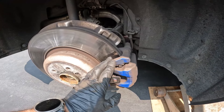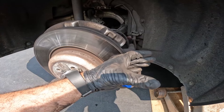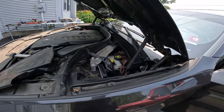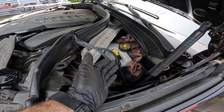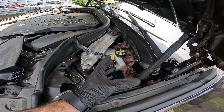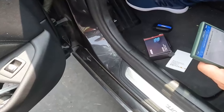Pro tip: do not take the brake caliper off on either side when you do this, because when you command it to retract it actually first expands then contracts. If you have it off, you'll blow out your piston — and that's a bad day. Also remember to check your brake fluid level; this one is a little too high, so I need to suck some out. When we compress the caliper piston, that fluid has to go somewhere, and if it overflows it could damage the paint.